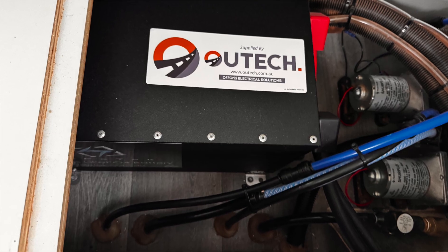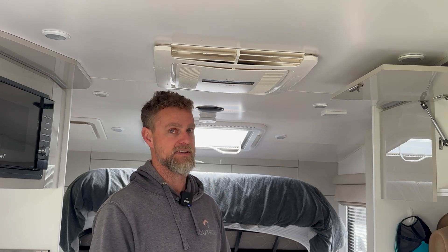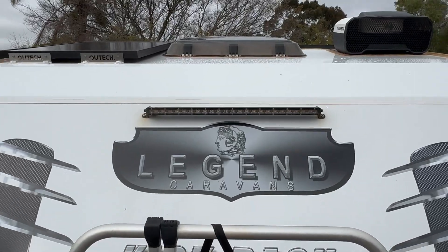We've ended up with a 410 amp hour Lifetech battery, fully compliant to standards, mounted here underneath the seat. We have 1100 watts of solar distributed through two separate solar regulators — 800 watts through one and 300 through another — all high voltage solar panels. We've repurposed their DC-DC charger, the Redarc BCDC50, underneath the seat, and we've also wired the solar input out to an Anderson plug on the side of the van so they can plug portables in and utilize that as a separate solar regulator as well.